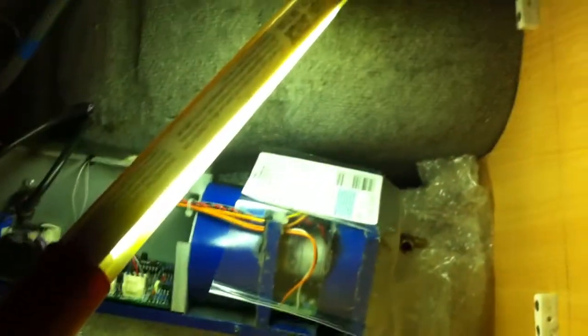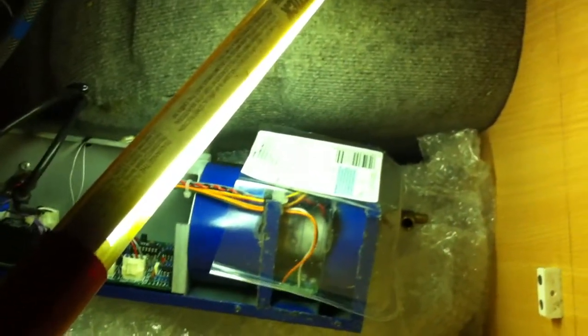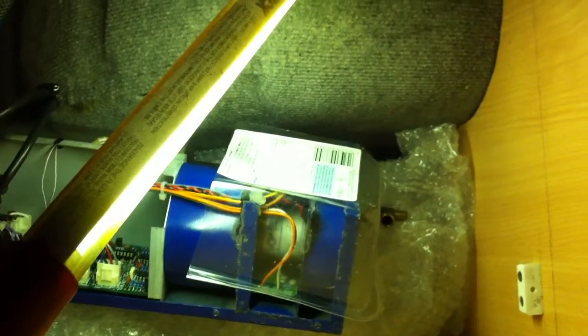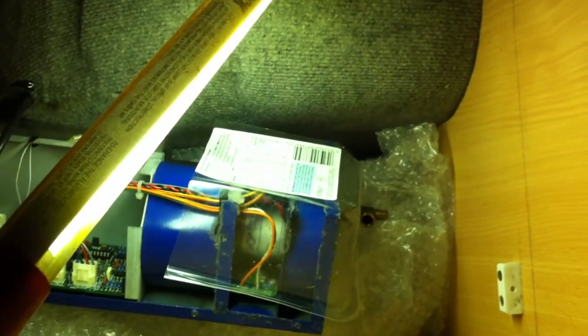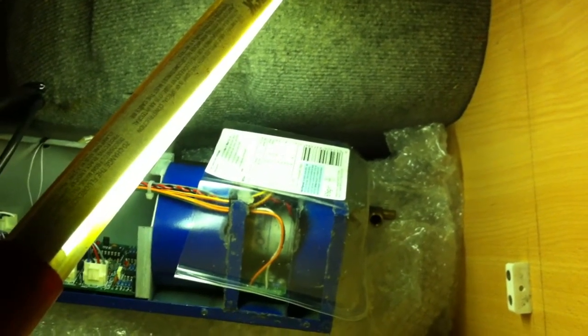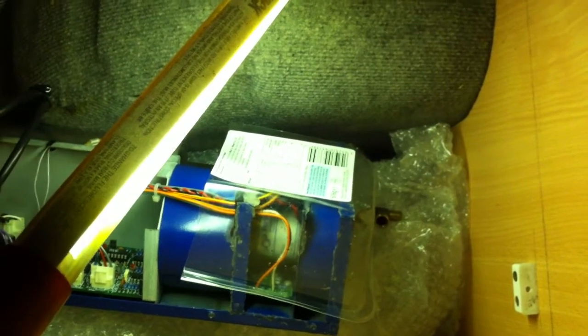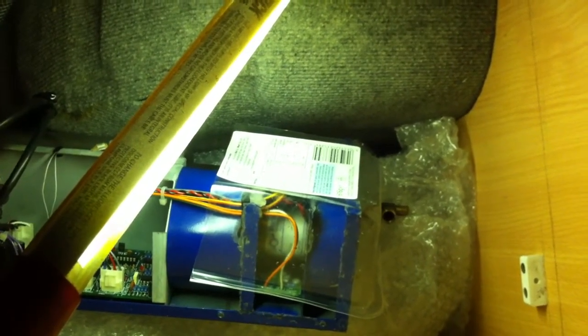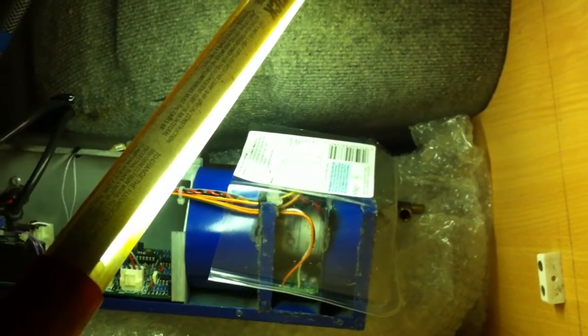So there — I think you can just see the black and white stripes stop and start as the fan came on and off, so it looks like it's spinning okay. There's no additional friction on the bearings or anything, so it was probably just the discolouration to the top of the disc which was causing the optics to not see the fan spinning. So hopefully that will fix it — I shall reassemble it now and connect it all back up.